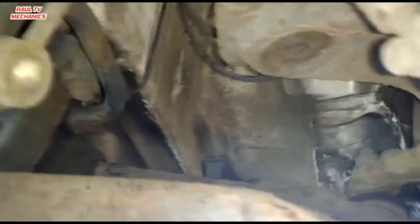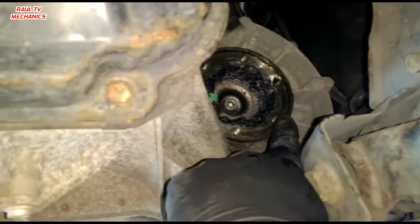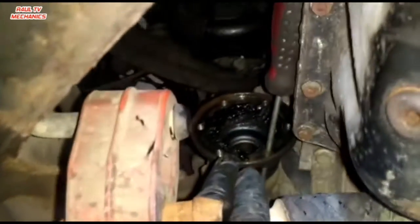We're gonna take the drive shafts off, which my brother's already taken off. I wasn't here when he took it off, but he has taken it off. It messed my video up. I will show you guys, right? Take the drive shaft off, center nut off here. Ball joint off there. He's already snapped one there, so that's gonna be another mission. And six bolts here, Allen key, M8, I think, or M10, the multi-spline Allen keys, take that off. Same on this side. Round the back here, take that off, take the drive shaft off, ball joints off, and we'll go from there.